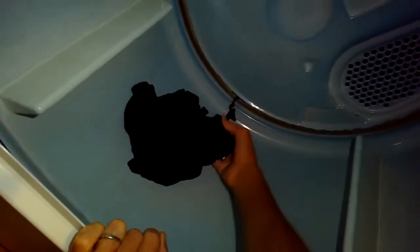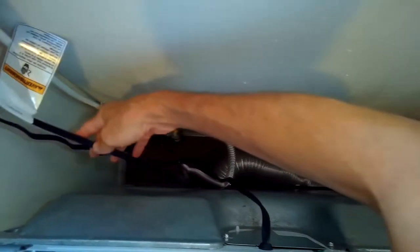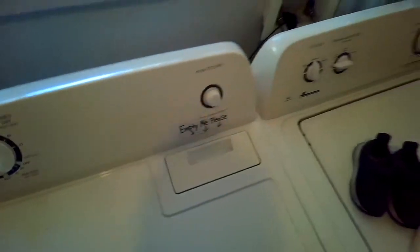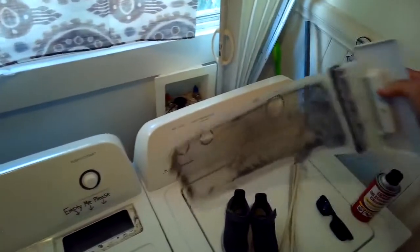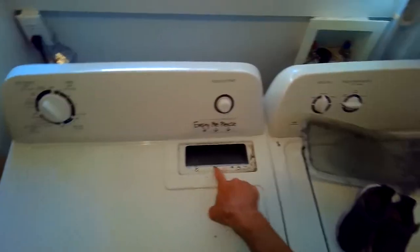The motor overheating could be because it's dirty or has too much friction stopping it from turning. I also noticed the vent tube in the back was crushed — that's not a good sign. A crushed vent means lint builds up inside the cabinet and gets the motor super dirty, so the motor can't cool itself down and overheats. This dryer already has a couple of things gone wrong, so I'm going to take it apart. I took out the filter and it's unplugged already.